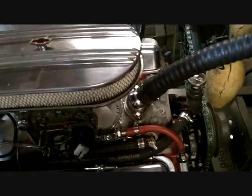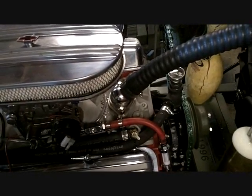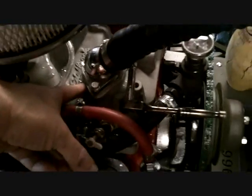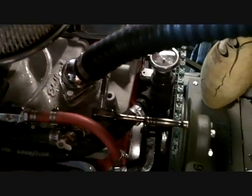Okay, probably going to change that or see if I can tighten it, which I doubt, it's loose. It's probably too thick for the damn thing. Well, after about 4 gallons of water... crap. The gasket is leaking on the back of the thermostat housing, no matter what you do. So I'm going to put this nice rubber one in.